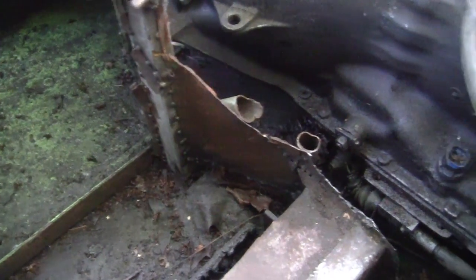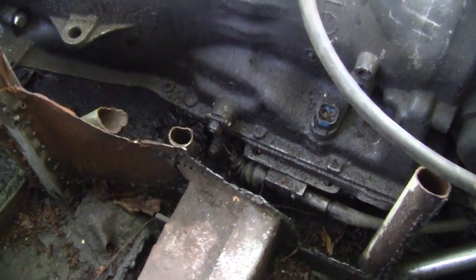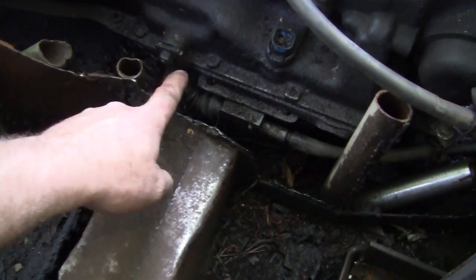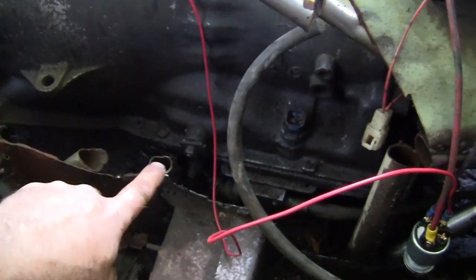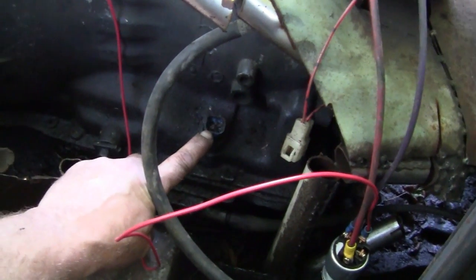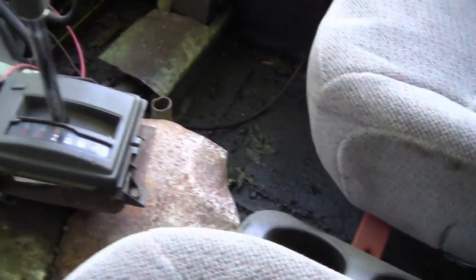I have a 1976 Chevy Camaro shifter and a shorter brand-new cable. I'm gonna put this cable coming in on an angle instead of pulling from the side, as long as it doesn't interfere. This piece here is out of a Toyota or some foreign car — the cable is too long for where I want it to sit, so I will be changing that. I think that connector there is for the lockup torque converter or possibly an overdrive — some of you might be able to tell me. It says '5T' on the side, I think it is an overdrive transmission.